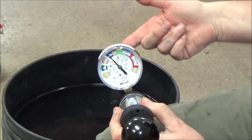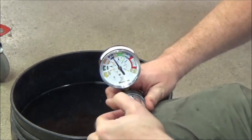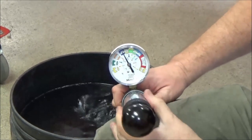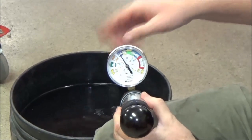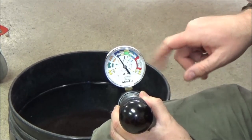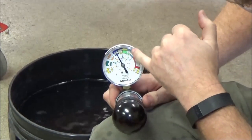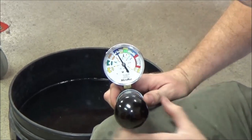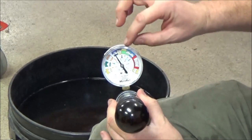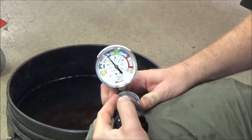Watch this — you'll see how I get a burst. We said we're sealed, right? See how there's nothing in here. This is showing that the radiator cap has the ability to bleed off too much pressure so we don't build too much pressure in the system. This cap is holding 13 PSI easily, and you can see when it gets to 15 to 16 PSI it's popping — watch for the bubble inside the water tank when the needle gets to right there.